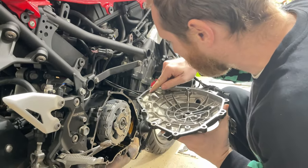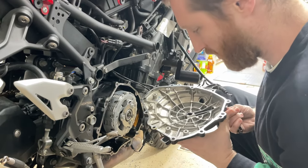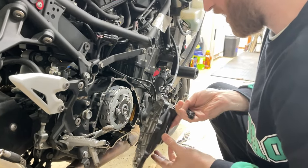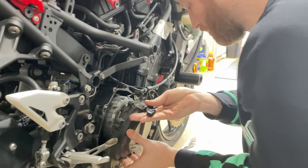Fortunately, I looked up the right one, and it was 89 inch-pounds. 89 inch-pounds, we went with that. That seems more feasible, because 97 on a little quarter inch 10 mil head, a 10 mil socket wasn't going to do it.